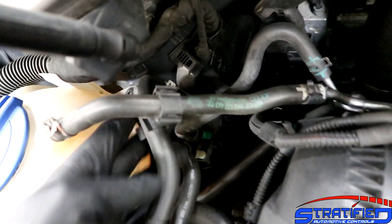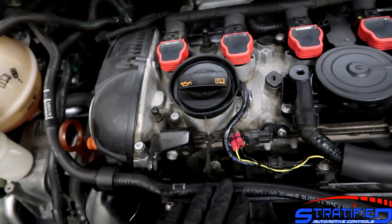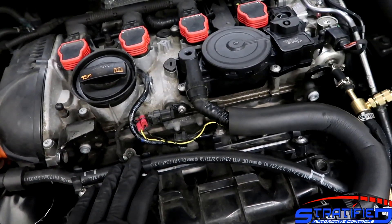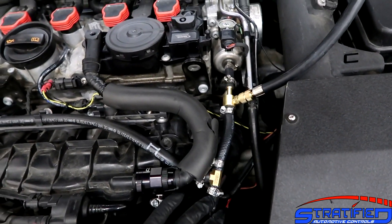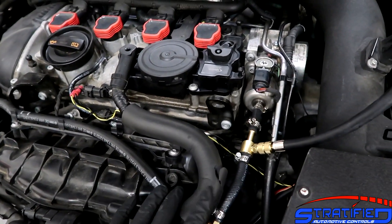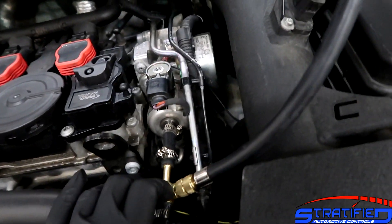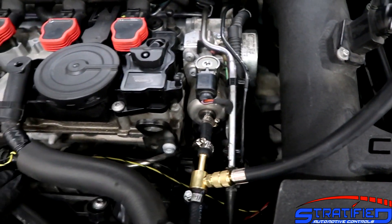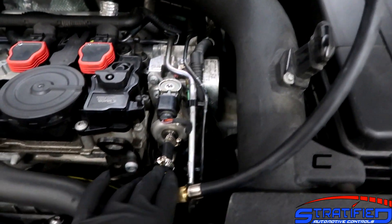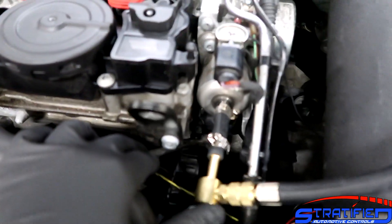This line right here — if you follow it across the top of your manifold — this is your low pressure side line. Pressure on the low side system can be anywhere from 40 to 100 psi depending on what the system is commanded to do. The pump is electronically controlled in the tank. This line here feeds into the high pressure side pump. The high pressure side pump inlet is usually not a steel line, so a lot of the time you'll see a rubber line like on this car, or a plastic end cap, making it easy to identify the low pressure feed. The high pressure line that goes to the injectors is always a steel line, so you don't want to tap into that.